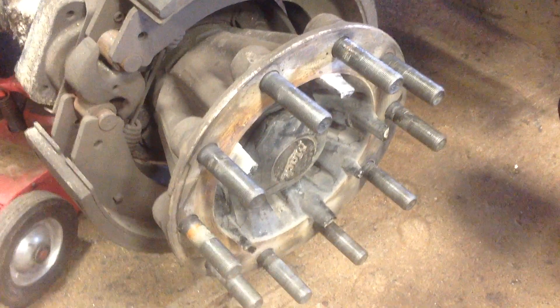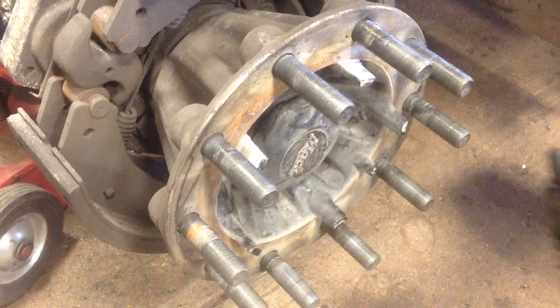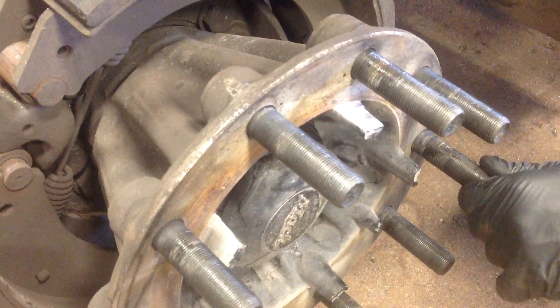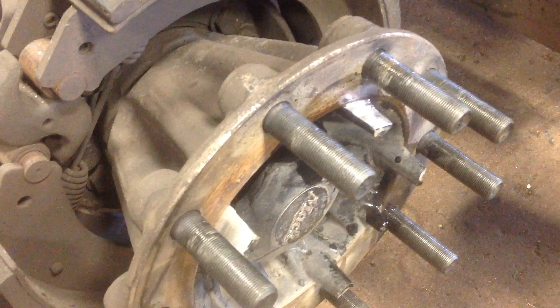Here we're going to zoom in on the hub that your tire and wheel is piloted. These outboard drums are piloted also. What we're going to do is clean these things called pilot pads that center your brake drum and wheel.